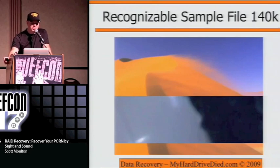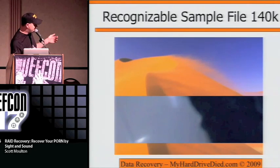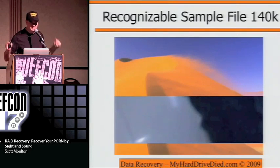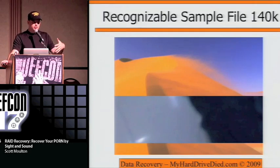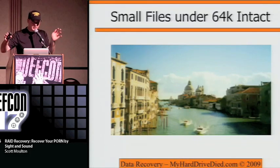Here are two files most of you should recognize — Windows sample files. They're next to each other and the slice sizes are wrong. This particular one came off the drive at 140K. As you divide this up you can start to see — maybe a 64K stripe size. You can tell almost right away. If you had non-JPEG or non-BMP data next to it, you'd just get garbage from that point on. We can actually use that garbage to analyze things. At the start of most pictures there's usually a thumbnail stored in the picture, so your software will still appear to extract data and you can use that to guide your analysis.